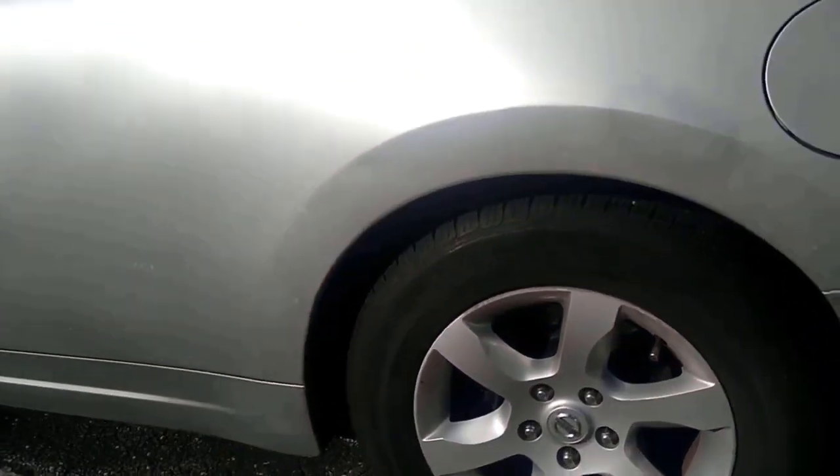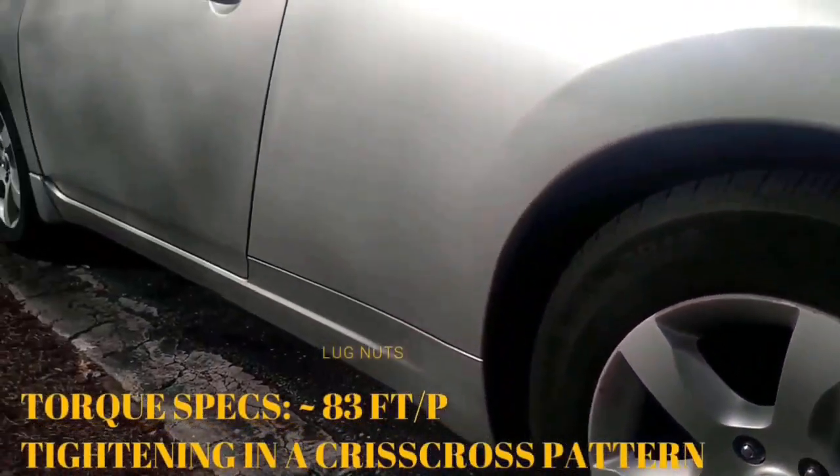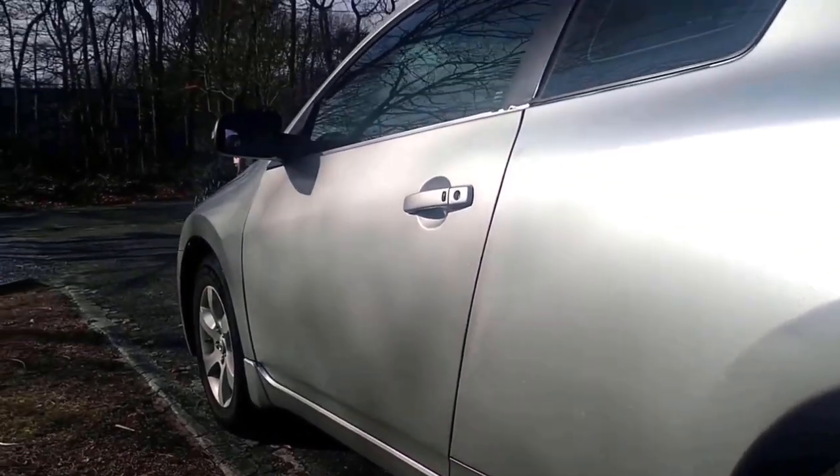Close the reservoir. If the brake pedal is not working correctly, make sure you have enough fluid in the reservoir, no air bubbles trapped in the system, and no leaks. This concludes today's project. Topics not covered in this video — how to paint brake calipers and how to bleed the entire brake system — will be covered in future videos. I hope you enjoyed this content, thank you very much, and I'll see you next time.